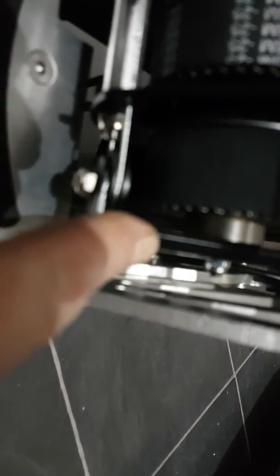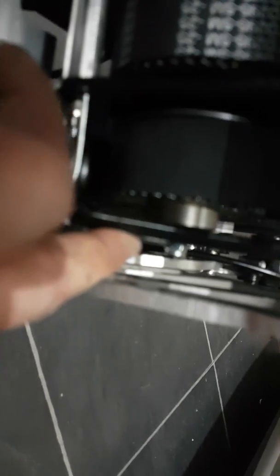After doing that, you need to get something to prise the shifter by here. So I'm using a spanner, and I force this until this bar, there's no movement at all in this bar. So by holding the spanner in position like so, it's really tight. Pull the excess cable through and tighten that bolt from behind. Once that's done, if it is in second gear and you select second gear, you won't be able to roll it backwards.